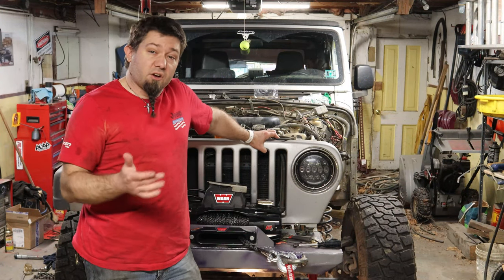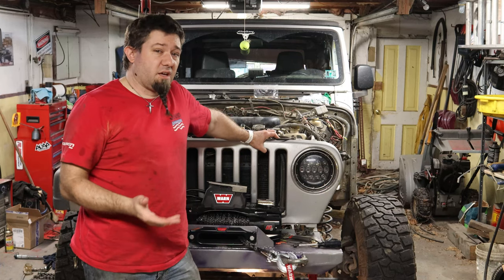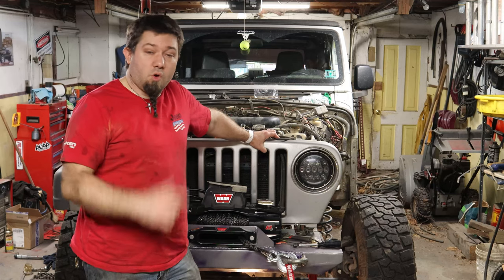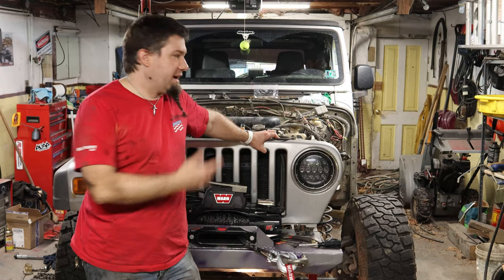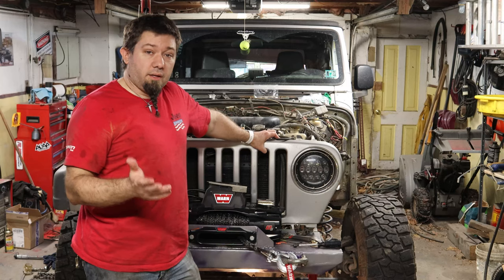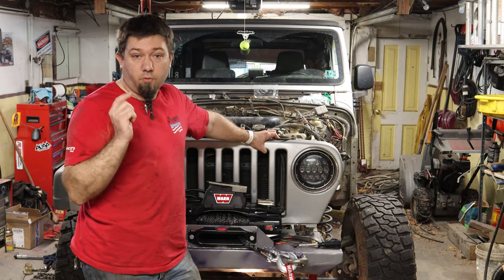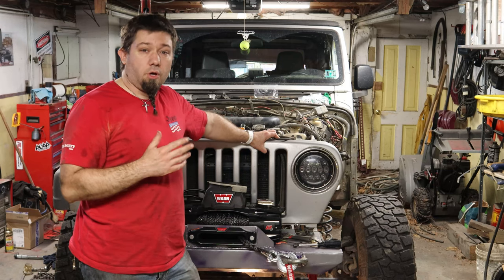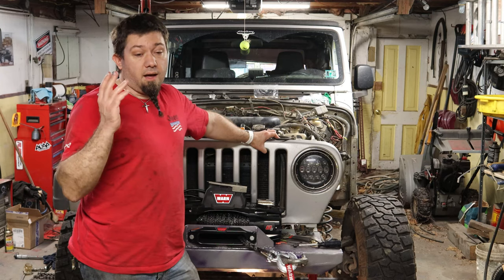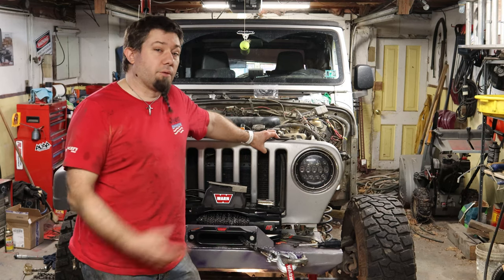Well folks, I know it doesn't look like I'm done, but believe it or not I'm just about done as far as the oil pan is concerned. My next step is to try to put all of this back together again. I've got some oil pan bolts to tighten up, and after that I'm going to switch the oil filter and the engine is ready to hold oil again. I did end up ordering new bolts and clips for the exhaust manifold - I pulled off one of the clips and the clip looks a bit banged up, so I'd rather just replace them while it's apart. I can put the part numbers for those in the description of the video so you guys can order some of your own if you run into the same problem.